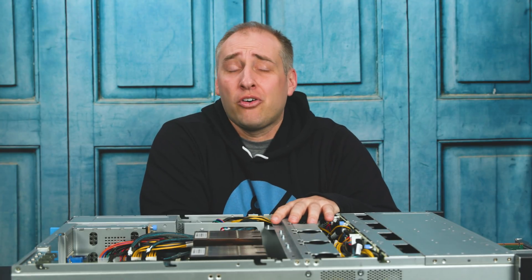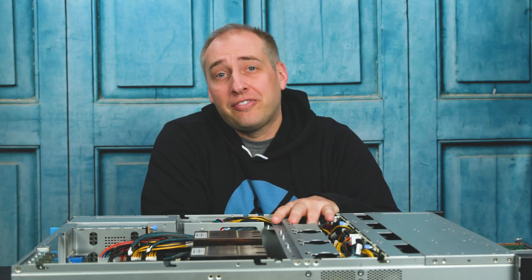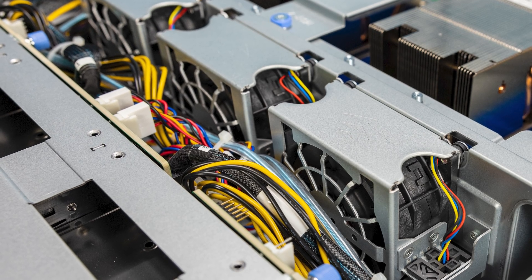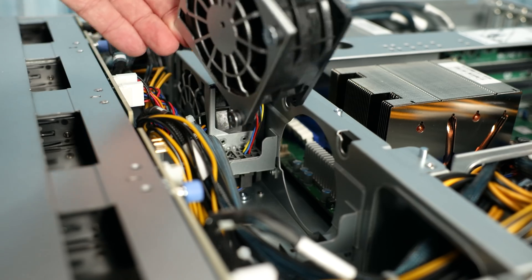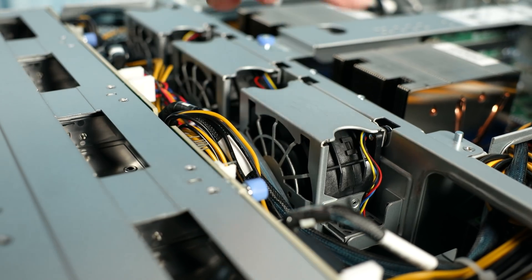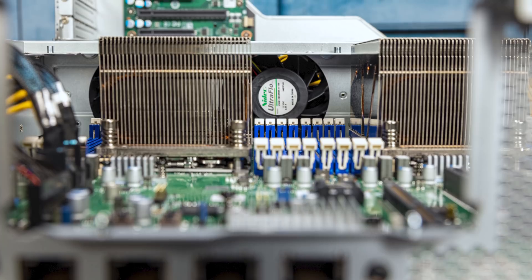We have the fan partition. There are only three chassis fans in this entire system, which is not a lot — sometimes we see these types of systems with four or five fans. Something else that's a little different about these fan holders is that they're all-metal designs, which is a lot different from what we typically see in the industry where fan holders are plastic units. These fans still have hot-swap power connectors so you can just pull them out and pop new ones in. You do have to do a little bit more alignment than with heavy plastic units, but having only three fans means cooling is somewhat limited — though not really that much.